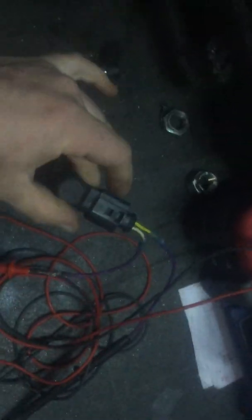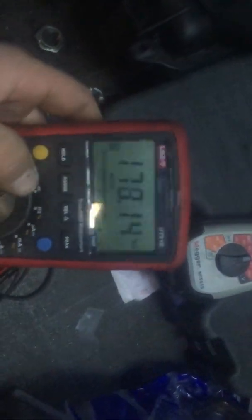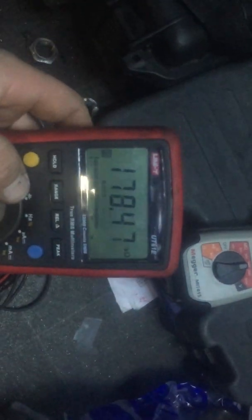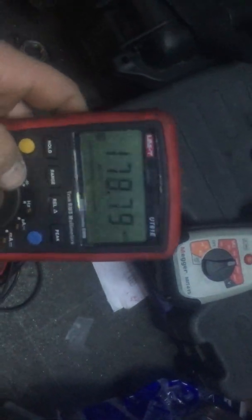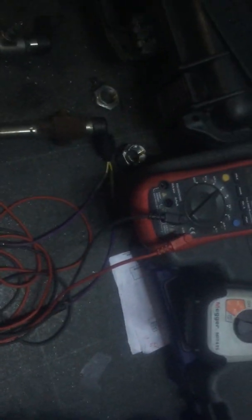Basically, we're going to run through just a couple of brief tests so you can have an idea of what's going on. First of all, using the ohm meter — we've got a plug that we just made ourselves, plug straight on the top of the injector. Using our normal ohm meter, the spec is between 180 and 200 kOhm. We also want to take our lead and check that we've got no continuity to the body.